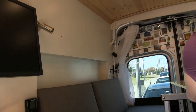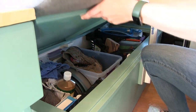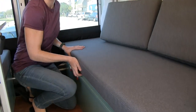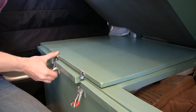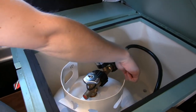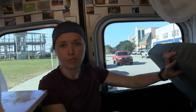These benches are comfortable but they're also full of storage — all of my storage is under here. On this side I also have storage with a sealed propane locker. It's tension-sealed and vents at the bottom with PVC all the way out to the bottom of the van, so when the tank heats up and the gas releases, it drops out the bottom.